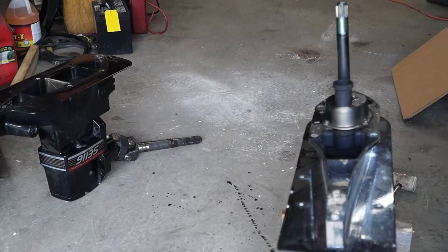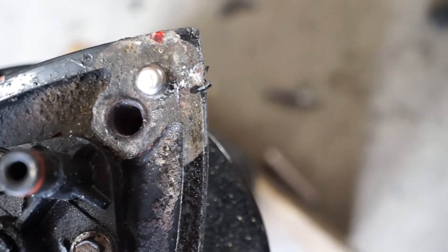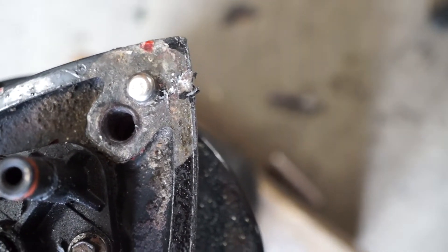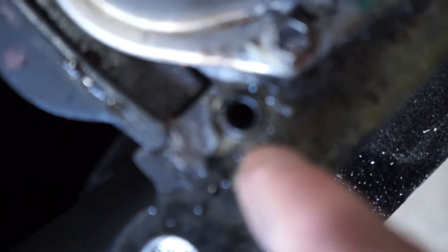As you can see, there's always that little bit that's going to drip out. What is getting frozen on these — let's zoom in — is the dowel pin right there and the dowel pin right there. Those are the major places you want to put grease on. So we'll pull this water pump off, clean this up a little bit, get a plug to put in the transfer hole from the upper to lower gear case, plug this off, and we'll do a pressure test again to pinpoint the other leak if there's another one under the water pump.